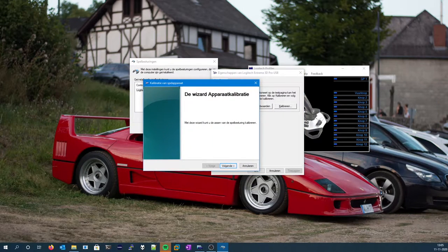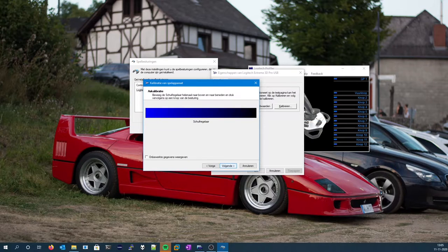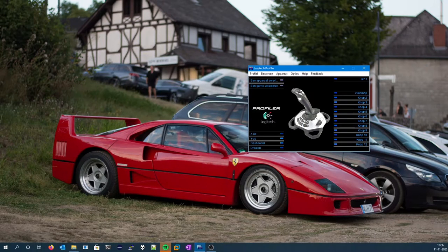If we actually calibrate it, in the middle you can see there's that strange edge. One second it's doing that and the other second it's not, so it looks like it's a hardware issue. Again it's not centered. The throttle axis is working fine. But the Z turn axis — you can see that there's a whole bar missing at the right. After calibration finished, the Z axis rotation is now working, but I don't think it will be the same potentiometer — they certainly both have the same issue.